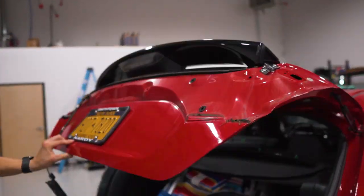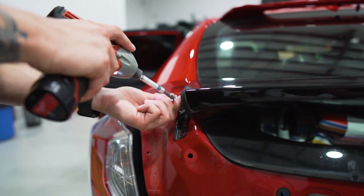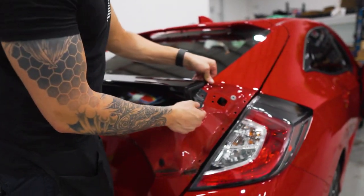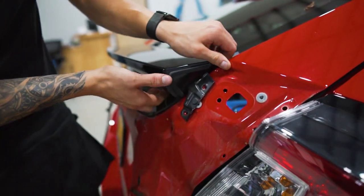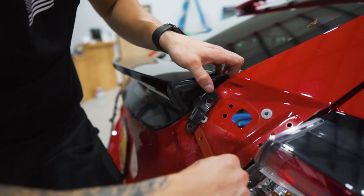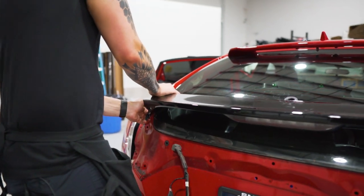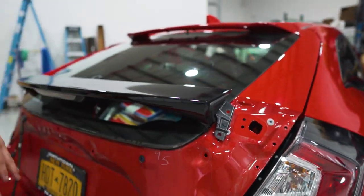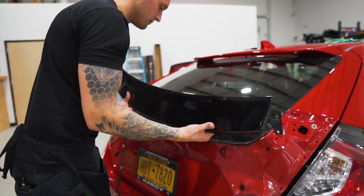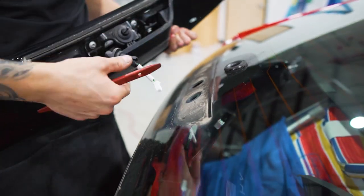Take the 10mm back on the outside — there are four more to take off, two on each side of the wing. Since we already unplugged the brake light plug on the wing, go ahead and pop it off. The clip in the center is kind of like a screw and a plastic grip — pop it out with one swift movement. You can loosen it side to side or stick a trim tool under there. Be very careful that the screw doesn't hit any painted areas — it's good to have a helping hand your first time. Once both sides are released, lift it up — there's a grommet here. Push it in from inside and pull from the outside to release it, and you can reinsert it later.